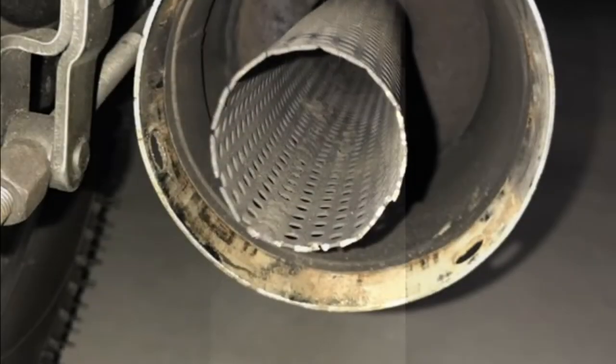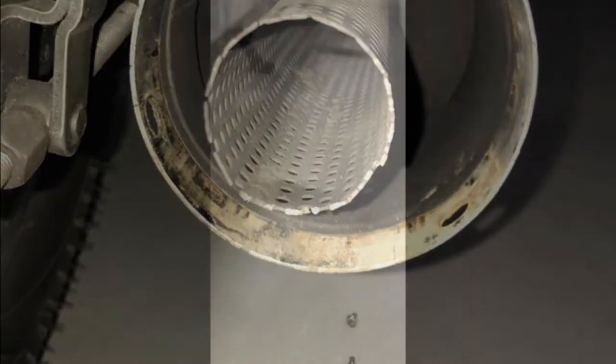So I will have to figure out how to fill in the glass wool. Now the challenge is I just opened the entire silencer and I cannot get access to this place. I am assuming this place here has glass wool, but this other place here has some amount of glass wool left. So if I have to fill in here, I have to cut it, fill in the glass wool, and then weld it again, which would look very untidy.